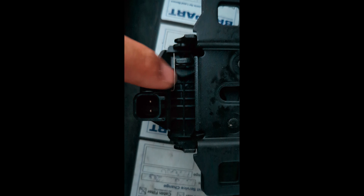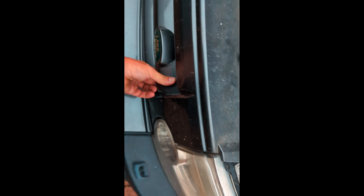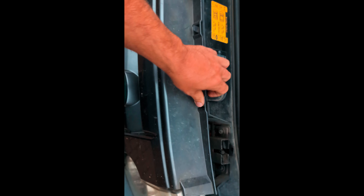There's your switch — a little micro switch there, which opens and closes as you open and close the bonnet. First job then: front grille off, with one tag under here, one under this side, and these tags across the top.